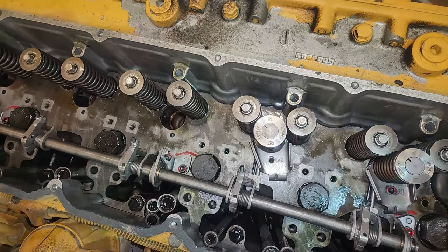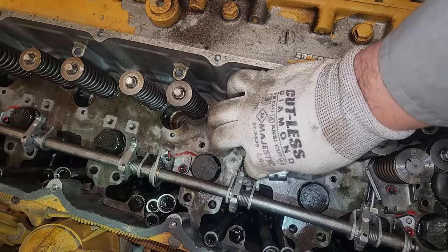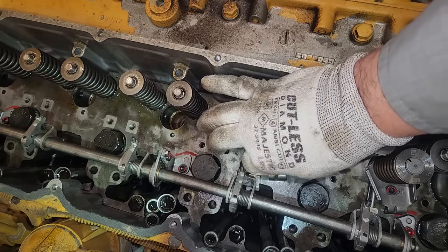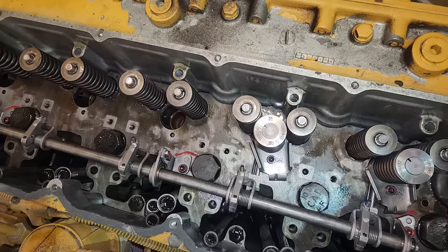So as the rack moves, which will make more sense in the next video where I'll show you how to do the rack adjustment, it is moving each injector to tell it how much fuel or how little fuel to shut off. Now that's where it gets complicated, because they all have to move in unison.